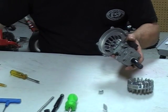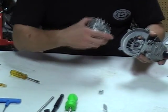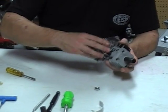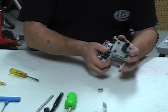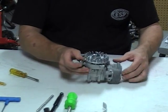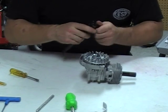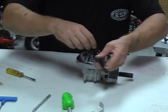Tap the key in until it's almost down to the bottom. Don't forget to put the key into the flywheel because if you don't, your ignition timing will be off and it probably won't start. The flywheel should feel nice and loose all the way down to the bottom — you shouldn't have to push hard with your hands. If you do, you might be stressing the flywheel at the keyway, which could end up with a fractured or cracked flywheel.